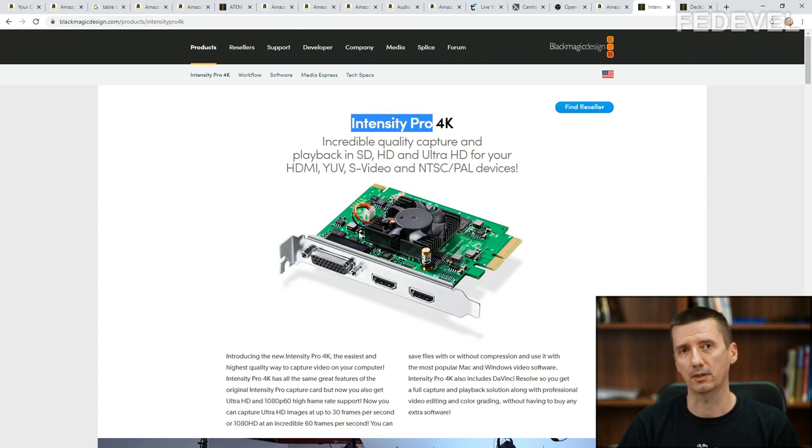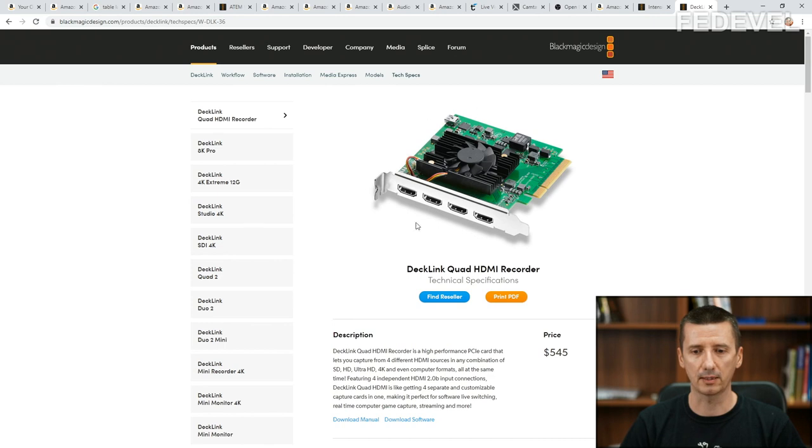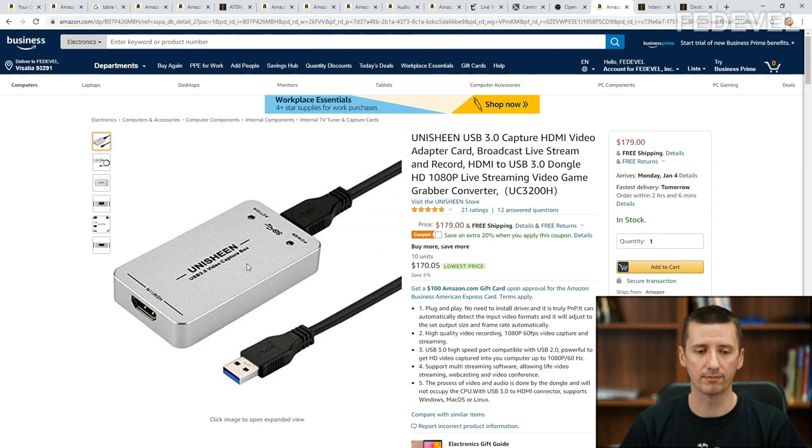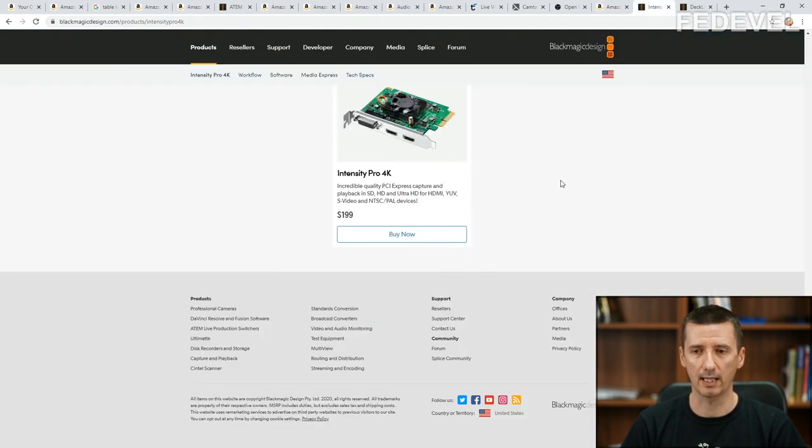If you're planning to record in full HD, consider using something other than USB devices for your video source. Go for HDMI and you may need this kind of capture card. The newer card can record four independent inputs and is more expensive, this one is around $200. Definitely don't buy the cheap HDMI-to-USB converter — it's useless and will never work as well as a proper capture card. Very important: if you want high quality video, buy a proper card so you can process the HDMI input directly.